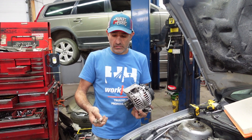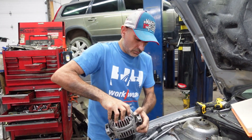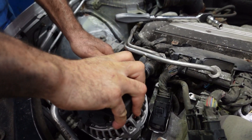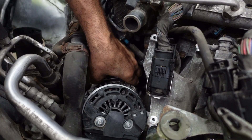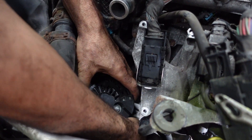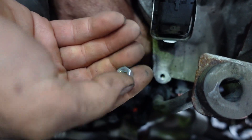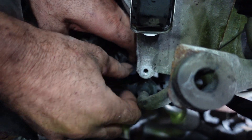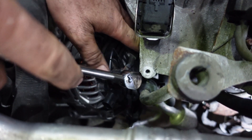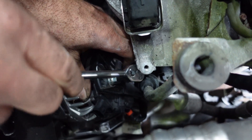Hi, welcome back to my channel. Part two is on how to put the alternator back in place. The four bolts are all similar length, there's no problem there. We're gonna try to slide it in, hold it, slide it back in place. Now we're gonna put the positive terminal back — washer and the new nut — and tighten the nut all the way so the bolt is tight.